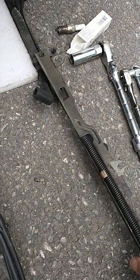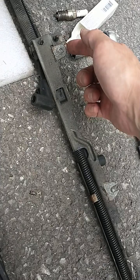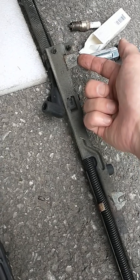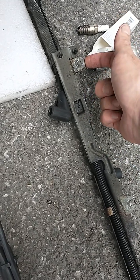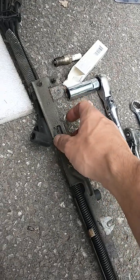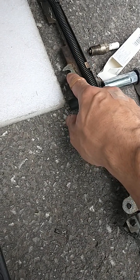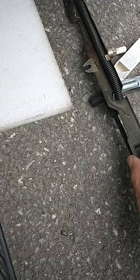This guy on the driver's side, there's a 3/8 inch bolt, and for here as well. This one's in the back, next to spark plug number 7. From there, you reach from behind the cross member, the subframe, with a combination of this or a 3/8 wrench. You take it out. Forgive me, this one is the other way around, like that. So that comes out, but this one you just loosen, because I'm telling you, if you remove it, it's going to be a pain to put back in. So I just loosened it enough for this to come in and out. So I pulled that out, everything came out, and I rewired it as is.